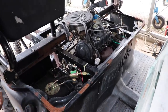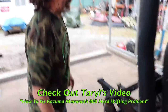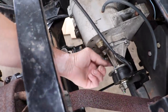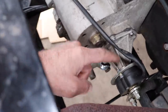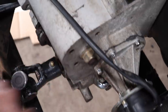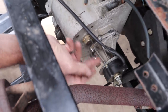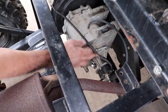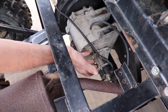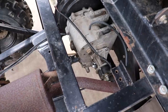I put the fuel pump in and then had to do the shifting hack. This thing wouldn't shift — right in here is that shaft where I added a grease fitting underneath. I could have put it on top, but water and dirt — I didn't want it getting in there, so I opted for the bottom. Now I can grease this shaft, because that was the problem: no lubricant getting to it, and over time water and moisture made it unable to shift.